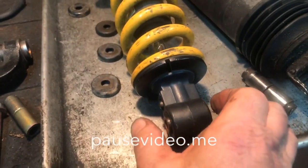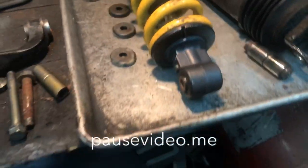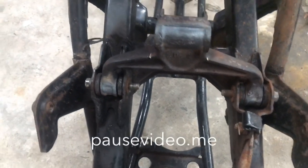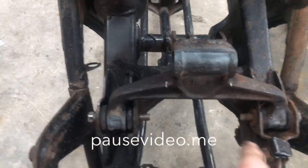When you put this in, you're going to need to space it out with some washers on each side to make spaces for it, because it's a little bit narrower than the original GL 500 shock. Also, if you're going to put this clevis shock mount onto a GL 650, the GL 650 frame is a little bit wider by about a quarter of an inch overall.